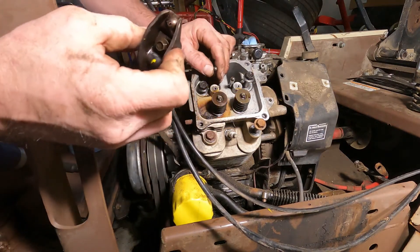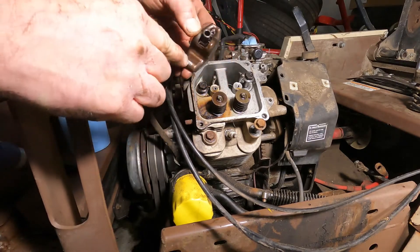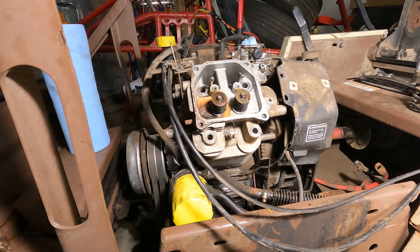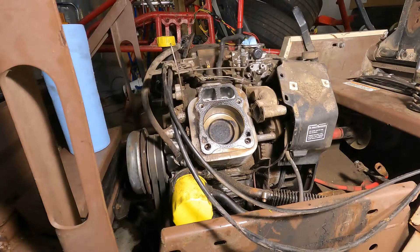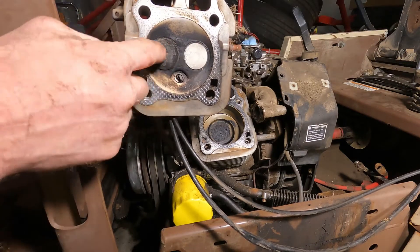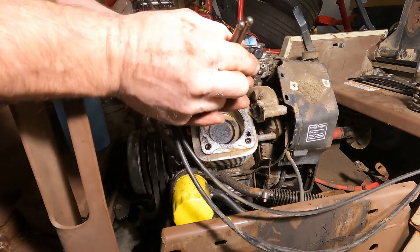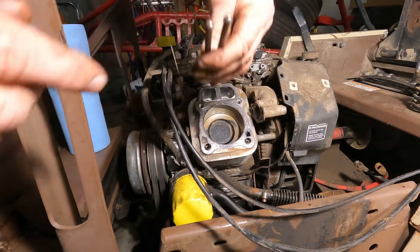They look good, they look nice and shiny, and these don't look bad. They're all the same size, but these have nice oily heads on them so we know which one goes where. It's just going to pull right off. So we're not looking bad on here — there's some carbon buildup, exhaust, intake — we can clean that all up, but nothing looks extremely horrible. The pushrods look very good. We took them out just like this, so one and two.